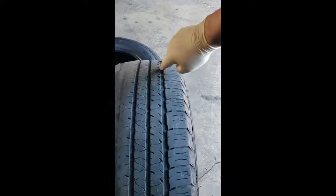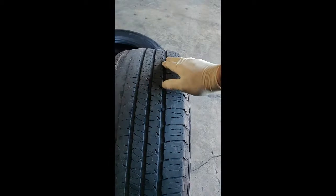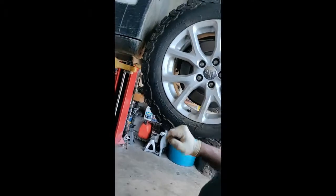It's a lowered truck — a Silverado, probably a 2003 or 2004 — and the alignment's off. I told him to go get the alignment adjusted so you don't eat up those tires. You can see from here how much tread depth it still has on one side, but look how bad it's worn out to the point where wires are sticking out. I've just been giving pricing to customers so I've been busy.